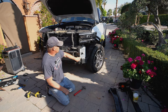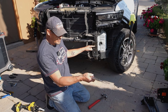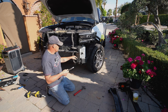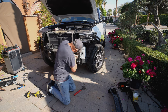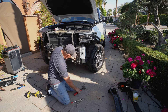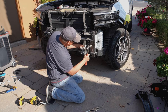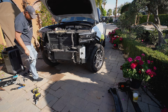We've cut both of these pieces off. We've got these two little studs that held part of the bumper on — they're tack welded in from the inside and we don't reuse them. So I'm just going to use a vice grips and a hammer and just beat them out, wiggle them a little bit to loosen it up. There we go — there's one, simple as that. And we'll do the same thing on the other side.